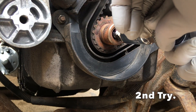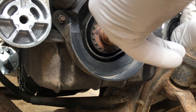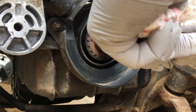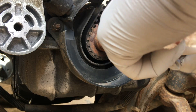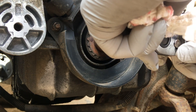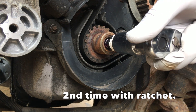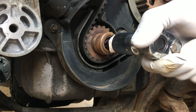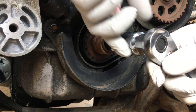Go to the point of resistance and then back off. Clean the chaser if needed and repeat. I was able to go further each time, then I used a ratchet for just a little more torque. Second time with the ratchet, the chaser went all the way in. I think it's past the bad spot now because I've got it way in there, so now I should back off.